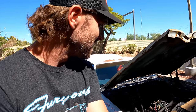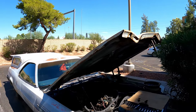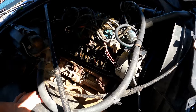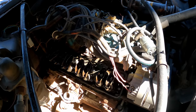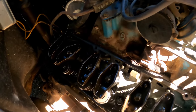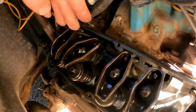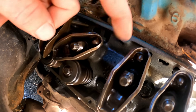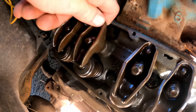We're a couple days later now - just been hanging out at the hotel doing some video editing and relaxing. Now we're getting ready to maybe hit the road again. This is our going-to-town rig, and I figure it's a good time to take a look at the valve train. We're going to do a proper adjustment on these. Well, that was the thinking until I pulled this passenger side off - check that out on number eight: the push rod is all the way down there, the rocker is just kind of hanging out right there. We got some major slop on this one.